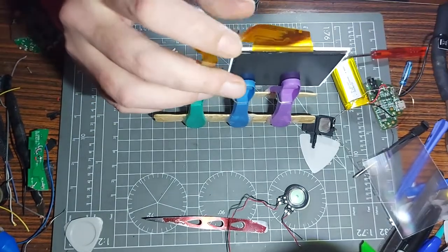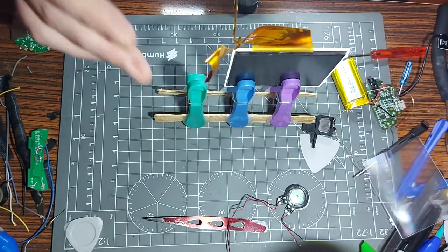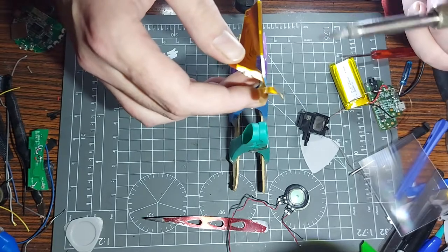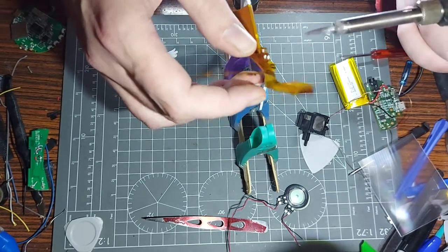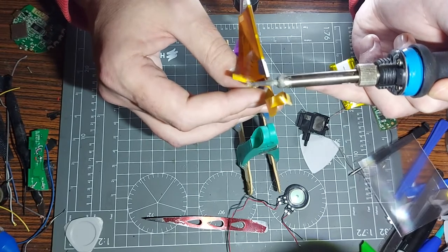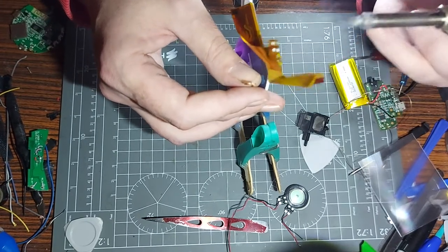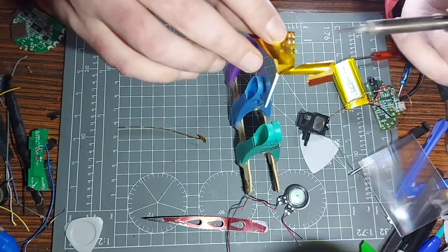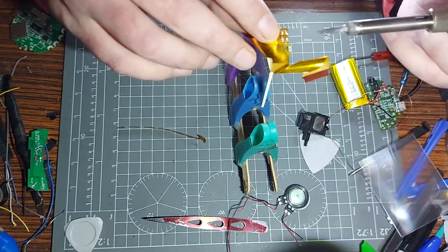This isn't technically soldering - this is de-soldering. You don't need to use braid or flux or anything. I just apply a little bit of heat and the job's done - it just popped off, and we've got two beautiful pads there which we can now tin.